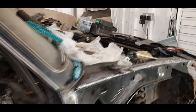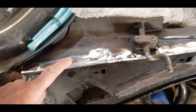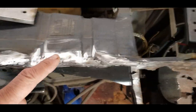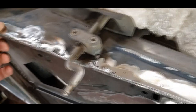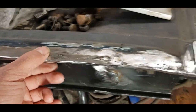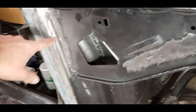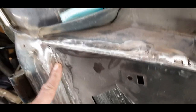So the replacement panel is in situ now. The original panel was spot welded through there, so I drilled out all the spot welds. It goes underneath and bends over that inner panel. I went ahead and MIG welded the holes up and flat-wheeled it all down. It still needs a bit more work. I originally painted this inner wheel arch support — the A-post support — with a two-pack hardener paint, and to be honest it's good stuff.